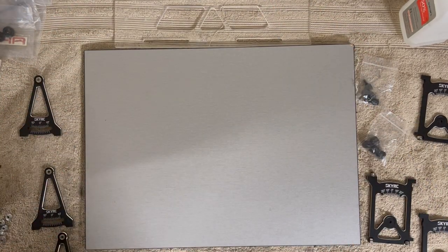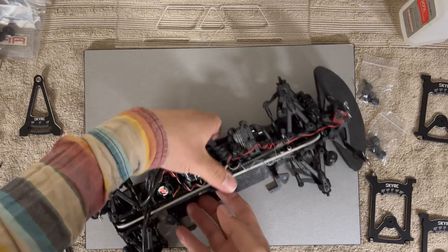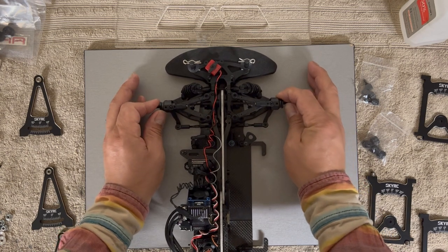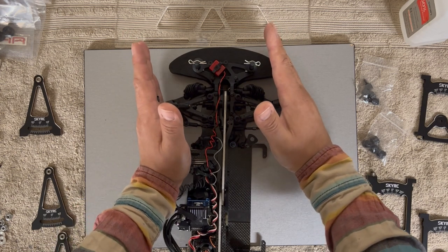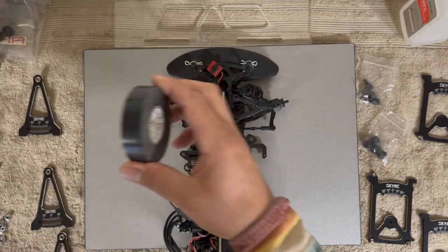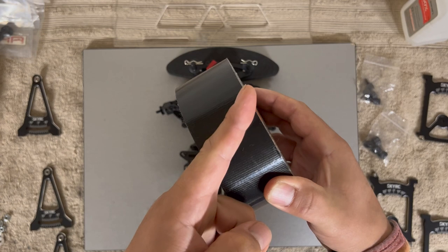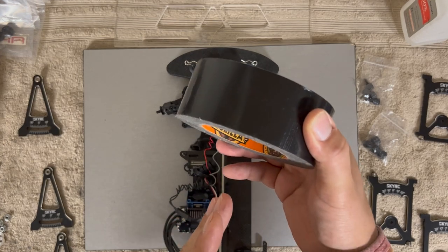There are many reasons why camber is incredibly important. Let's say the camber is off — one tire is straight up and one is leaning in. When you take a turn and weight shifts to the outer tire, if that tire is angled two degrees, as weight transfers it'll go somewhat flat, giving you a larger contact surface and quite a lot of grip.